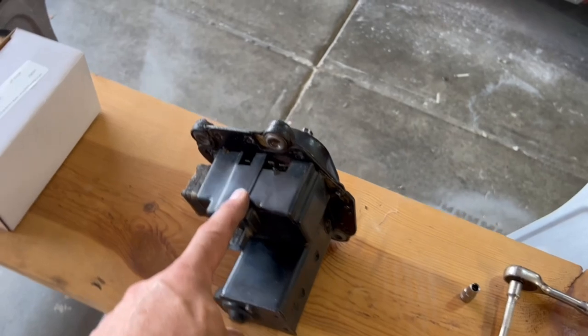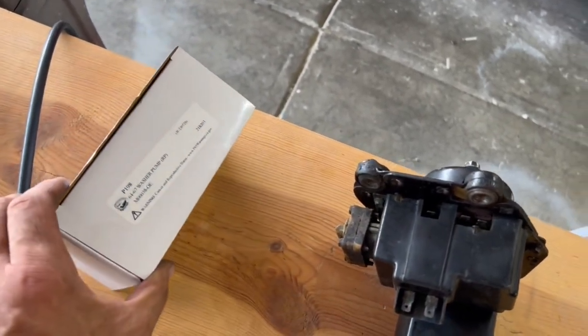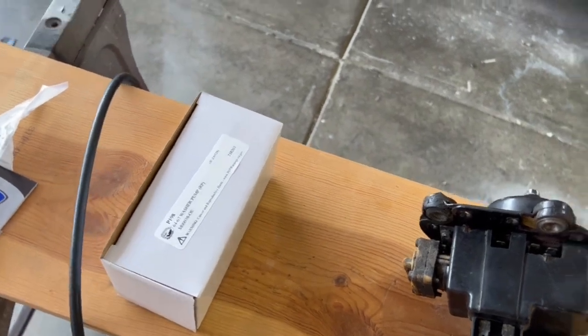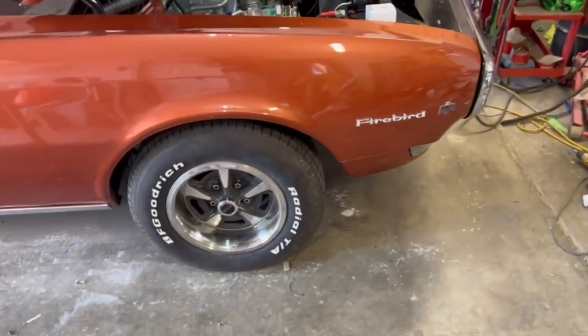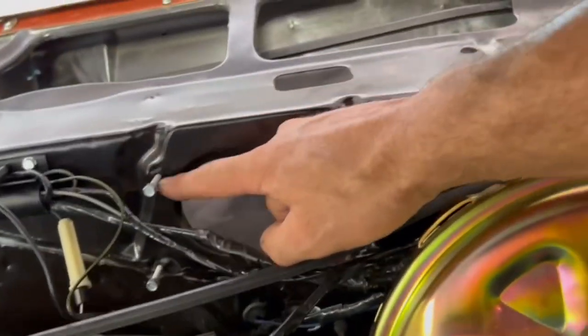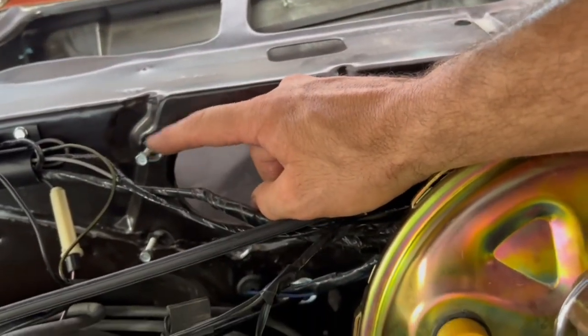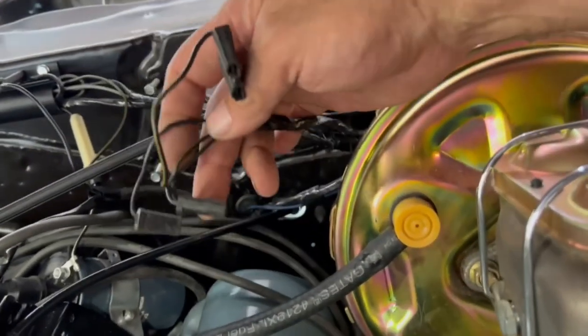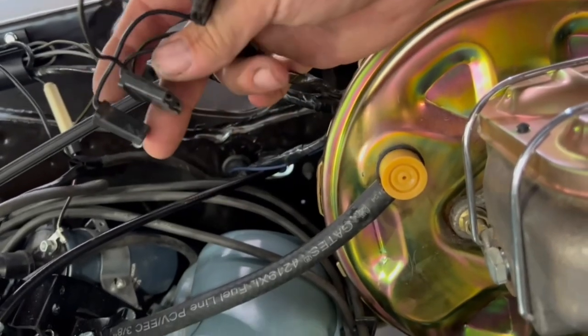I have a pretty good feeling I know what's wrong with it. Someone had ordered a new washer pump kit from Ames, went ahead and bought that, got some washer tubes. Under the hood, there are only five wires that operate this wiper motor on the firewall. One of the most important things is that it has to ground out to the firewall — so make sure you've got good clean bolts to get this thing to park. If you have a parking issue, you may just have a ground issue on your wiper motor.